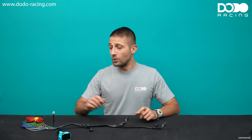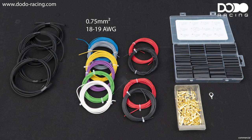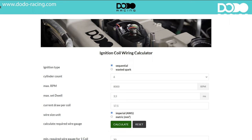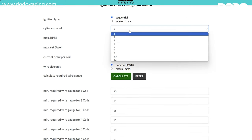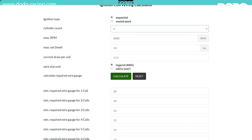Then of course we're going to need some wires. Here we have some 0.75 square millimeter trigger wires in six different colors and some power wires in different gauges. Technically you could go smaller, but I like staying above 0.75 for strength reasons. For picking the right wire size, we've built a calculator — you can find the link down in the description. Here you can put in all of your data and the calculator will tell you exactly which wire size you're going to need.